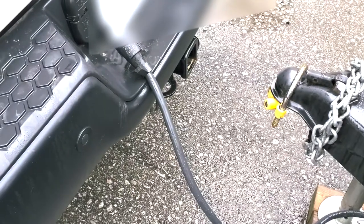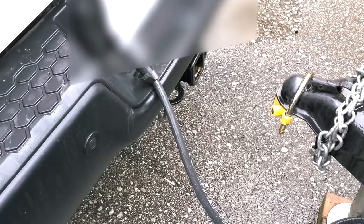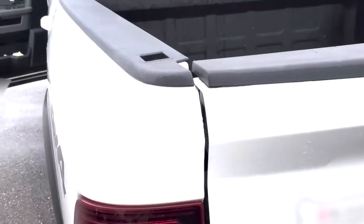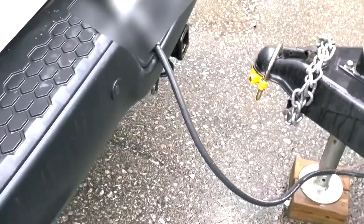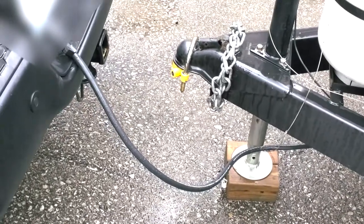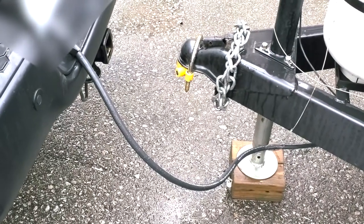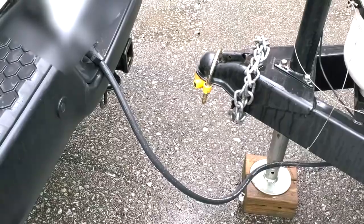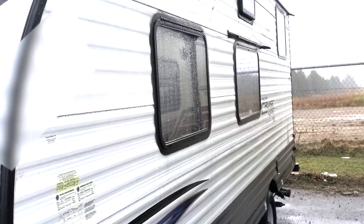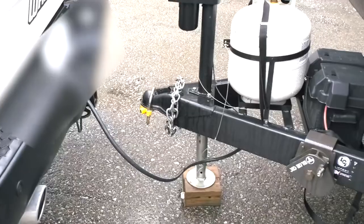On a whim I asked them if there could be a short in the seven-way plug — maybe a small short was blowing the fuse, because the electronics in these newer trucks are probably pretty sensitive. So the RV dealership said sure, they'd throw a new seven-way connector on the camper and replace the cabling at the front, though they were very skeptical this would resolve it. I drove out to pick up the camper, hooked it up to the truck, plugged in the cord, and lo and behold, everything worked. Hallelujah — we could go camping, be safe, not break the law.